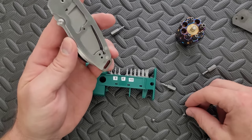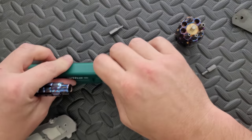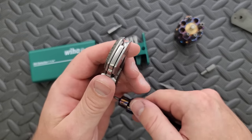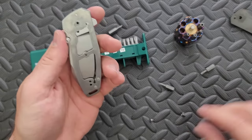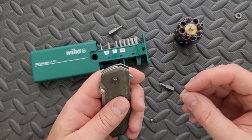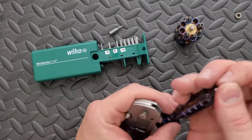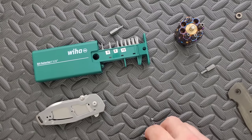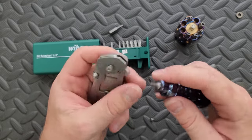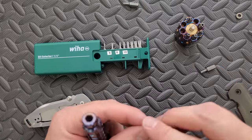I'm going to try to do this on camera so you guys can see. The reason we need to get down to the frame screws is that they're actually part of the process when you're centering. These frame screws look like they're going to be T6, so let's loosen those up just a little bit. This is going to be a little bit tricky. I need to be able to access these screws during all of this. Having two drivers is always a good idea — I'd recommend just getting a couple of fatties, they're pretty inexpensive.